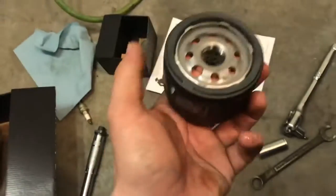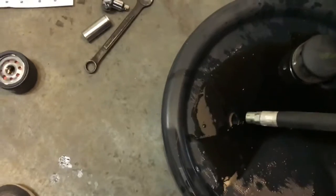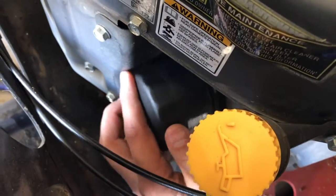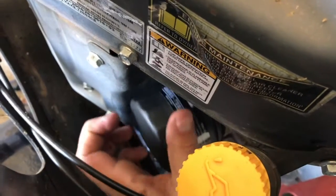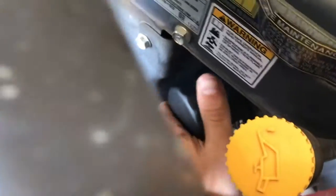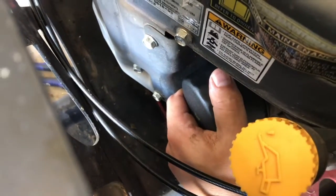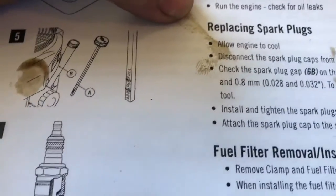I'm going to lube this oil seal O-ring on the filter and then replace it. Wait for the remaining oil to drain, then get it put on. I lubed the oil filter O-ring and cleaned the base where it mounts — make sure you do that. Install the oil filter, make sure it starts and spins freely, otherwise it could be cross-threaded. Just tighten it down about hand tight. Once you start it and run it, check it to make sure it doesn't leak — hand tight is usually tight enough.